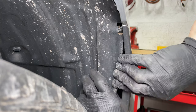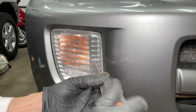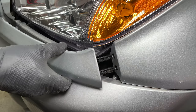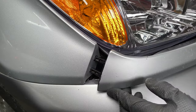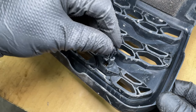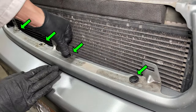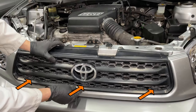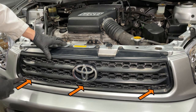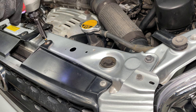Install the screw in the corner and tuck the plastic fender liner back into place. Reinstall the turn signal light — the outer edge goes in first and the screw goes in second. Gently set the metal trim piece on top of the bumper cover. Two plastic tabs go into the fender on each side — push them and they will snap into place. Twist the plastic grill clips to remove them from the metal trim, then snap the three clips into the grill. Don't forget to install the four plastic push pins into the metal bumper trim. Now install the grill and be careful while snapping each plastic clip into place. The fatter screw goes into the corner of the grill and the smaller one goes into the metal trim. Finish up by installing the rest of the screws in the grill.